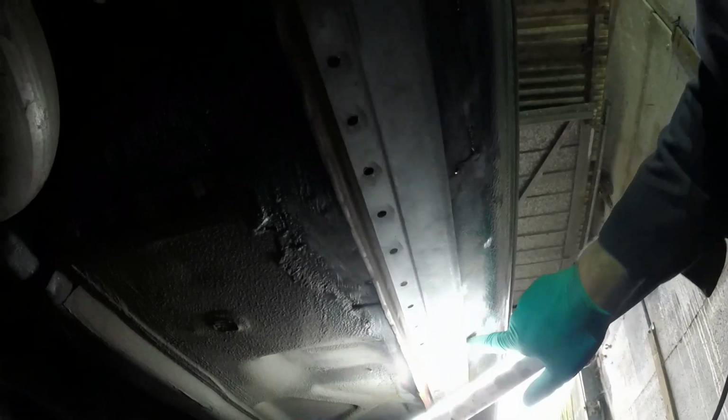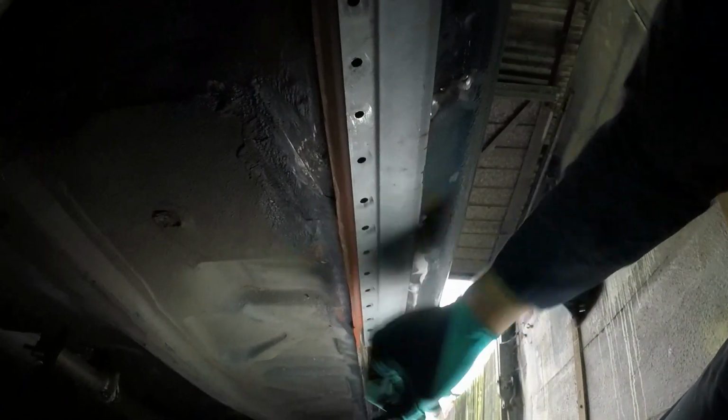The other thing is that lines up nicely, and I'm starting to think what I'll probably do is just upside down weld along that edge, try and nip that smooth, and then hopefully it'll look all right. On the other side of the car, obviously I didn't have that problem because the whole sill was done and that line looks really nice. The other option is, excuse the noise while I attempt to show you, the other option is to tuck all of this inside there and chop the existing sill back on the car and then weld into it. I still haven't fully made my mind up.